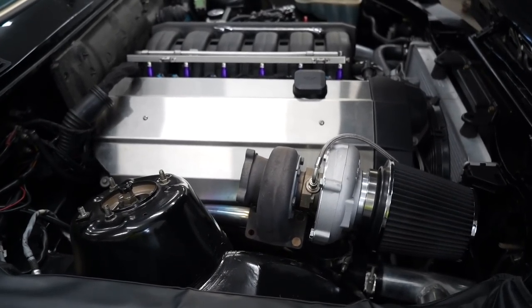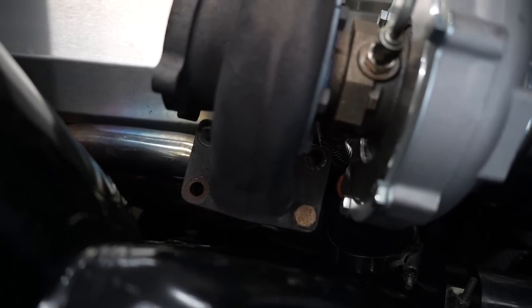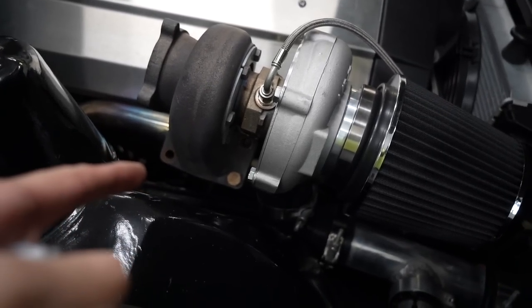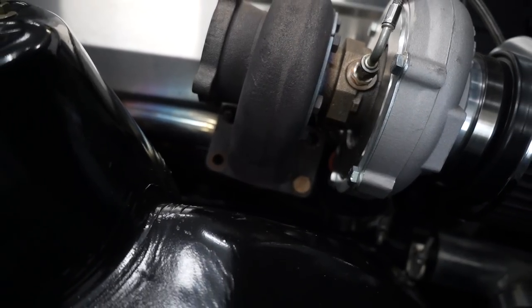The cover is on, everything is on, the coil packs are good. I don't know where my other turbo manifold studs went, and because of that I was using a normal bolt on that bottom left one. The bolt ended up cross-threading the threads and I had to re-tap it again — so that left one in my manifold is a lot weaker. I got some stainless steel hardware on Amazon so hopefully I can have all matching hardware and not mess any more threads up.